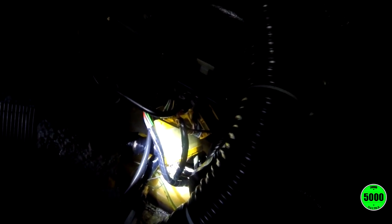Back connected, and like I said, there were four bolts. There's two there, there's two over here, and then there are three connectors. There's one that's about 2.5 inches wide, one that's about 1.5 inches wide, and then there is a kind of oval shaped connector, and then of course you also have the duct work for the defrost vent. But anyway, that is back connected. The speedometer is hooked up, and we're gonna take this thing for a quick ride and see if we've got any issues.